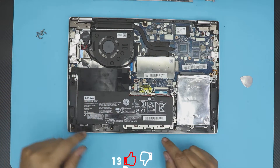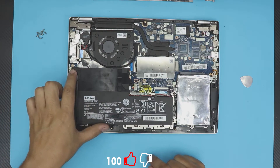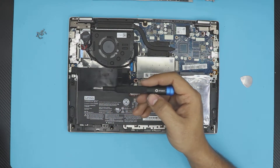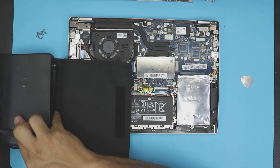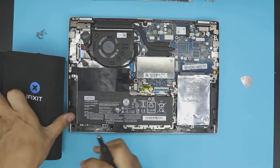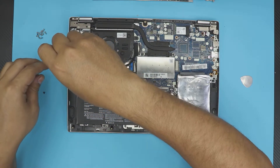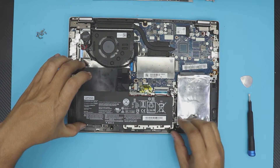To remove the battery, there are two screws holding it. I use my iFixit tool set — they're really handy, they come with all the bits and sets that you need; I'll leave the link in the description. Remove these two screws — they are the same size so don't worry about mismatching them.